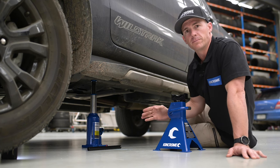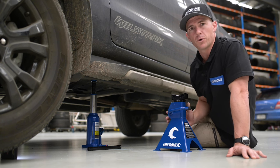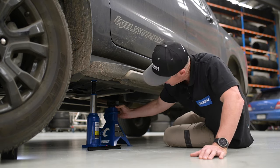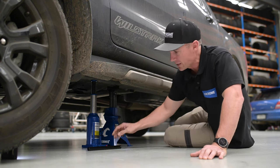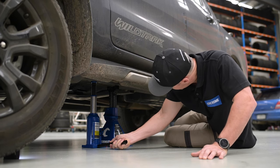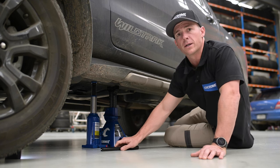The jack's done its job — it's raised the car. Now we're at the point where we need the jack stand. The jack stand supports the weight of the car. Never ever work under the car without the jack stand. Now we raise the saddle of the jack stand; the ratchet will do its job. Get it to the highest point. Now we can release the load from the jack itself onto the jack stand. Anti-clockwise to release the jack. Now the jack stand has the weight of the car.